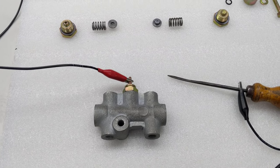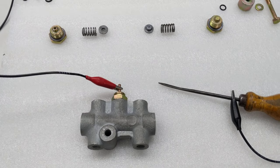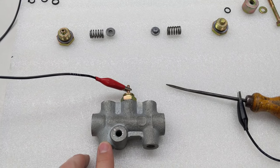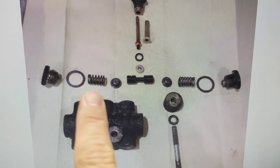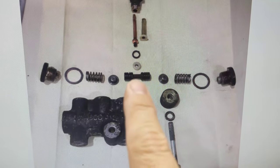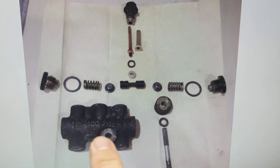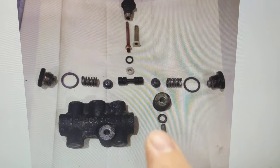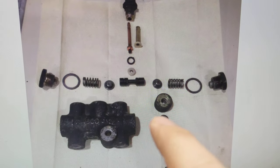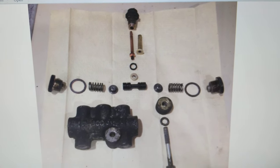I was really curious to see how this brake warning light switch works — this is from a 240Z. Basically you've got a chamber here for the front brake system and a chamber there for the rear brake system. In the middle you've got a spring that sits in there and a spring that sits in there, with a valve that sits in the center. This pin here goes down through the center and it normally doesn't touch that valve. When you've got a pressure difference from your front to your rear brake system, that valve gets pushed to one side, contacts that pin, and that pin is connected to a wire which is connected to your brake light switch inside the cabin.